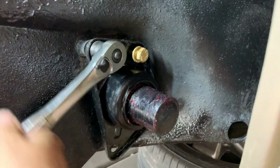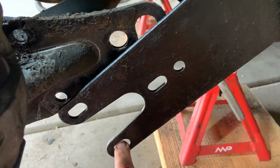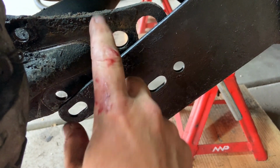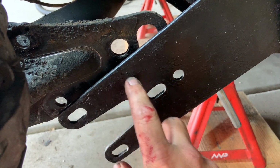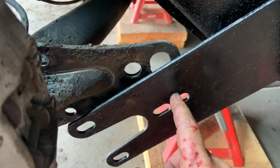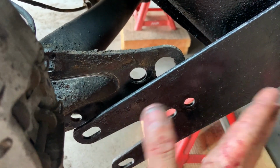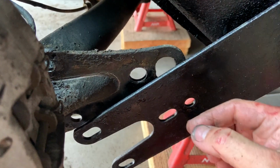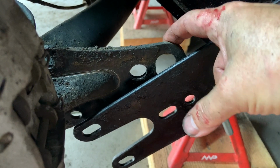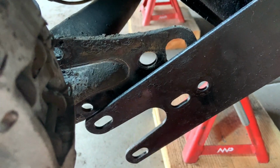I wanted to take a moment and show you these holes back here. Remember, these are the holes of the bolts that hold the spring plate to the banana arm. It's these two, and as you can tell, the differences adjust your toe in and toe out and your camber up and down and then side to side. So that's what those look like. And those bolts, remember the 12 millimeter Allens go on the back side, the small one goes here, the big one goes here, and those go in, and then we'll get this back one situated as well.